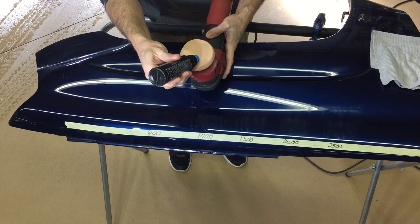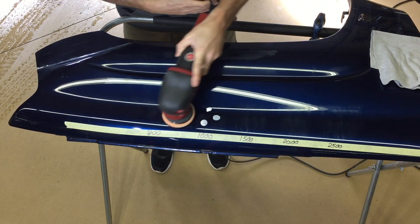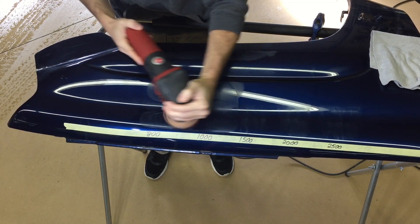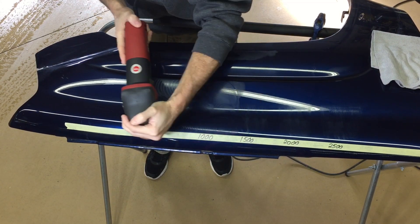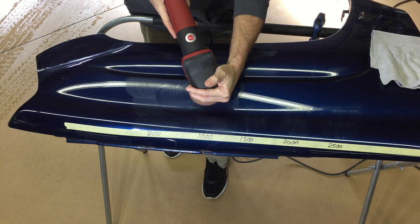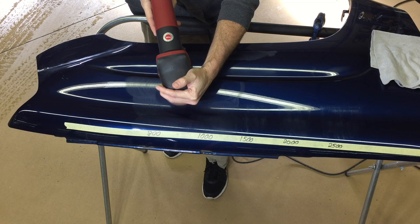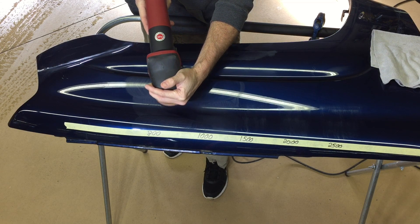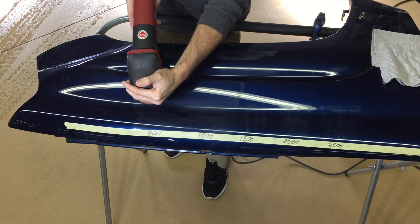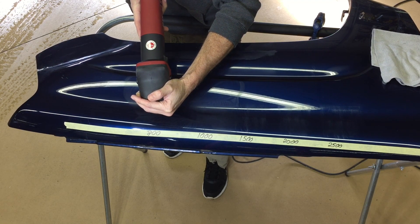Just like in all the other tests, we're going to concentrate now on the last two sections — the 800 and 1000 grit sections. We'll reload the pad and do a little extended working time on this area. I'm looking at a few things: how long the open time or cycle time is for this compound, how long we can work it until it turns into an oily film, how bad the dusting gets, how hard it is to remove the residue after raising temperatures, and whether it does any additional work on those last two sections.